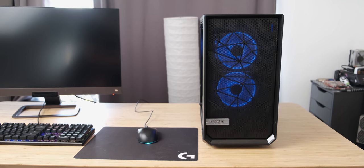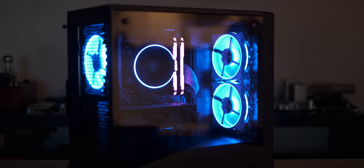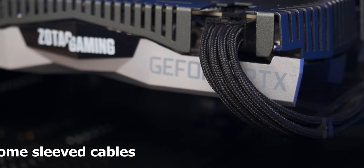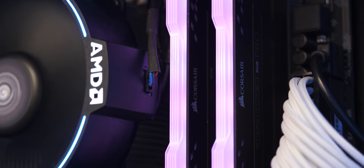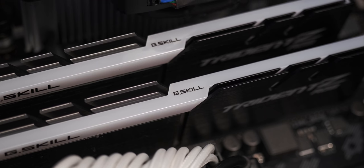It turned into a little bit of a neon looking thing — it wasn't intentional, but I kind of like the way it looks. I think it looks really cool. When it came to installing Windows, it was very fast. The more eagle-eyed of you would probably have noticed that I've got different RAM in there, because the system refused to overclock the G.Skill Trident Z that I had in there above 2133 MHz. Then I put the Corsair kit in and it just clocked straight to 3.6 GHz on the memory.